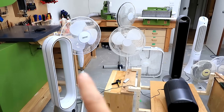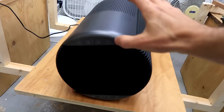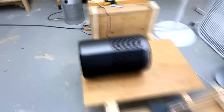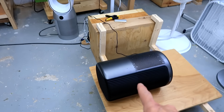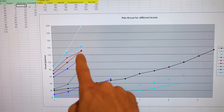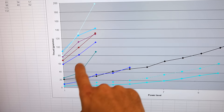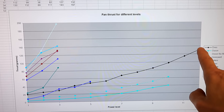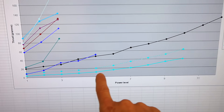Because the setup is fairly fast, I've been testing all of my fans. Thinking about the relatively low thrust of the Dyson, I also measured the thrust of the air cleaner from DRIO, which isn't really meant to be a fan but blows pretty hard — and we're getting 37 grams of thrust, meaning it's almost as good a fan as the Dyson, and it's not even supposed to be a fan. Here are my results: the cheap regular fans have just three levels. The box fan has the most thrust, and the rest vary quite a lot. Down here we have the tower fans — the DRIO is the only tower fan I tested that can keep up with propeller-type fans. Blue is the Honeywell, which doesn't go that high. And way at the bottom is the Dyson.